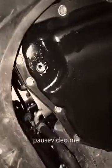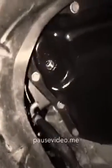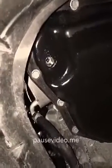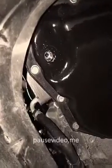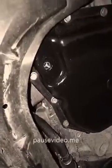Okay, I put that tube back in there, tighten it back in place there. There you see that Allen head screw it's got on. Threads back up in there. Now what you have to do is leave the drain plug out, keep a drain pan below here, and go to the top and start filling the transmission.